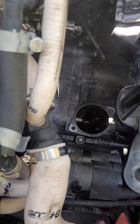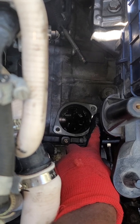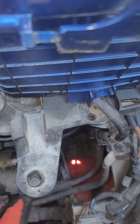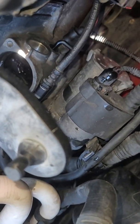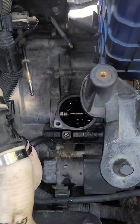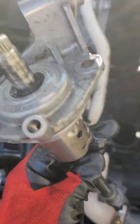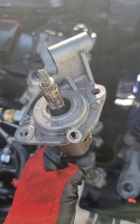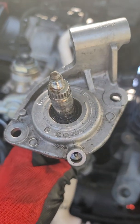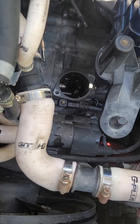Nothing worked, so I decided to take out the selector tower. What I did was remove the T13 from here, and I also removed a T16 — right there — which looks like this. Then I just got a flathead screwdriver and pried it up and it just came out simple. That is how you take out your selector tower from the Mark 5 GTI Golf.